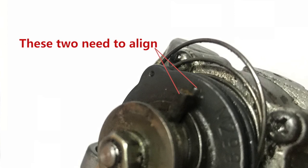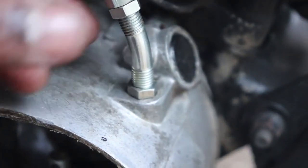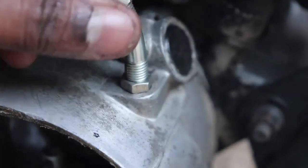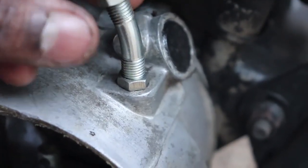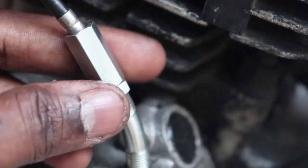In a simple case it can just be a piston scratching against the cylinder walls, which is not major and is kind of reversible to an extent. But if the engine seizure happens over a period of time — as I'll give an example of later in the video — you may lose the crank, the connecting rod might break, the piston can break, and the sleeve inside the cylinder can break. So a lot of things can go wrong.